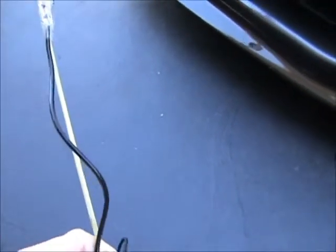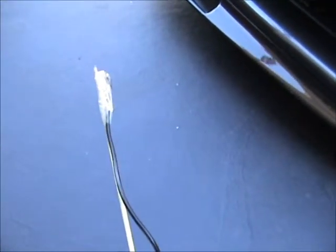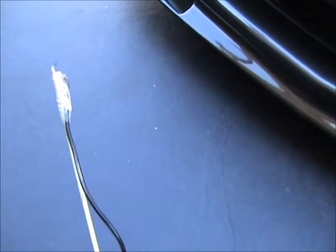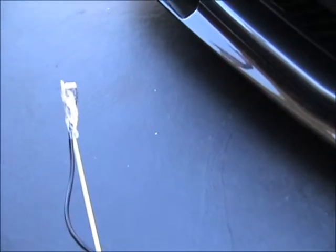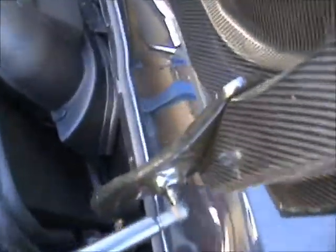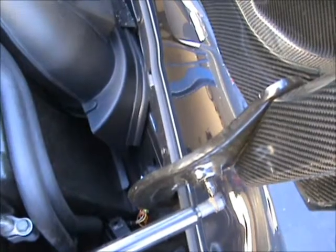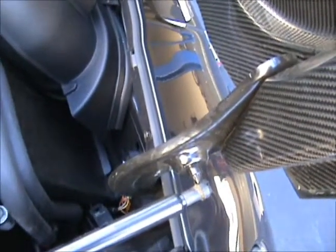The first step is to get the sensor through the grill — get the USB connector from the back side of the sensor through your grill and up into your engine compartment, then through into the passenger compartment to the control module. I've taped the end of the sensor plugged to a fish — you could use a coat hanger or a straightened out coat hanger. I chose to use about a three-foot long plastic fish and I'm going to push it up through the front of the grill at an angle and go through the firewall.